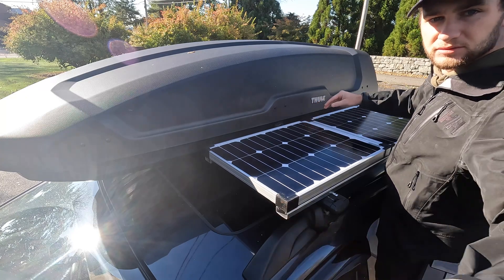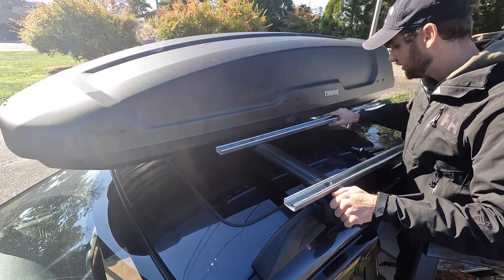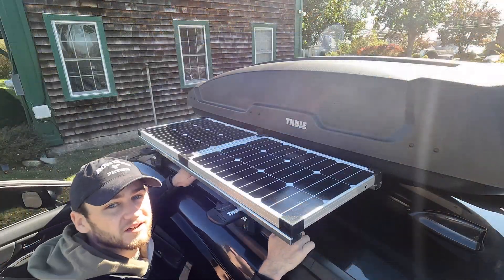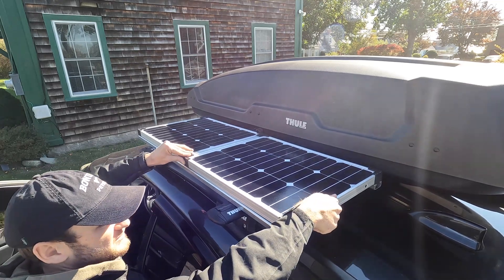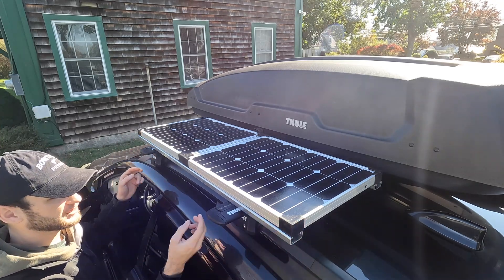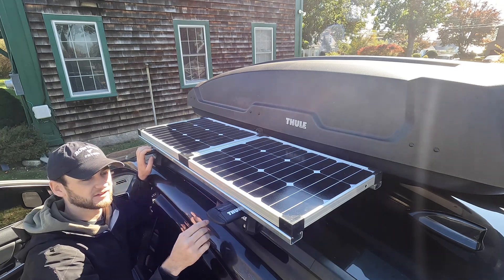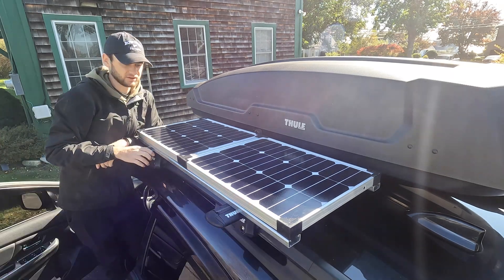When I cinched everything together it shifted the rack slightly and almost created an off-center for the box, so I'm going to lock these in place first — stupid mistake on my part. The panels are cut up nice and rigid. I retightened everything just to make sure the locking washers inside the channel are aligned perfectly at 90 degrees, because if they're spaced incorrectly the struts can't turn 90 degrees and won't be fully locked in.